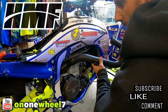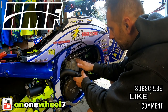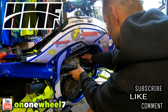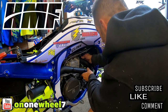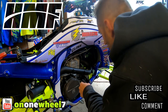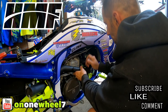Get the header in here loosely. If you guys are doing this for the first time on an older bike, this gasket is brand new, but if you're removing a stock exhaust system for the first time, I'd recommend changing the O-ring in here — you want to put a new one in there so you get a nice tight seal on the header. I'm not going to tighten these all the way, just snug, so I can move the header around, get the muffler on and bolt it up, then tighten these fully. Once it heats up I'll double check them too.